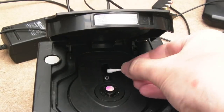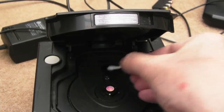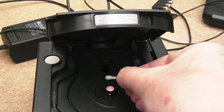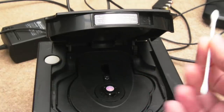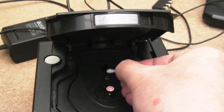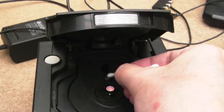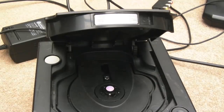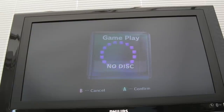Before I tear this down, I'm just going to get some IPA on a cotton bud and gently rub the lens. This is different to floppy heads — you don't want to put much pressure on these, because there are tiny little coils on the servo that hold that lens and move it for focus and tracking adjustments. The less you stress those coils, the better. Let's give that a try. Yeah, still saying no disc. So we'll tear these down now.